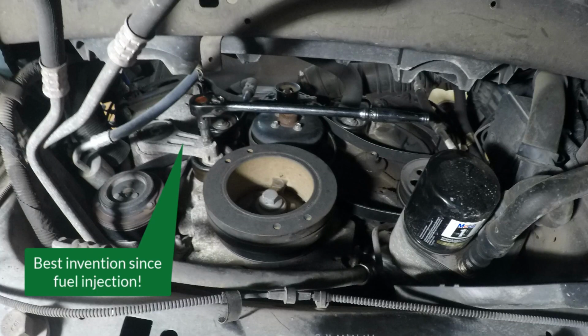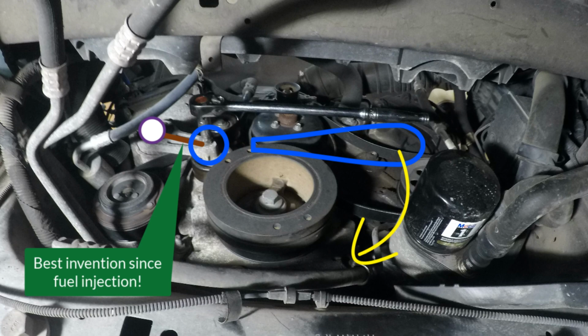So I do want to say that the belt tensioners they have on these modern cars are great. They maintain the right amount of belt tension through springs, and all you do is put your 1/2-inch ratchet in there, and you pull down, and the spring kind of releases, and you can get the belt off the tensioner or off one of the pulleys and pull it all out, and you just put it back the same way. These things are really nice, a whole lot nicer than the old-fashioned way of prying it over with the bar, each individual component, and getting the belt tension just right, or too much or too little, and getting squeaks.